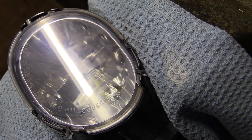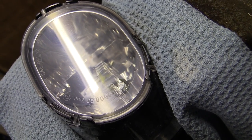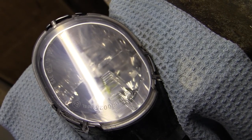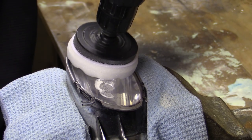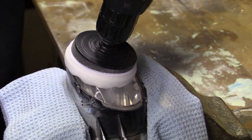Following a few hits with the pair of pads, the lens now looked like this — no heavy pitting to be seen, which was good, but plenty of light hazing which needed polishing out with the Auto Glym headlight compound. A small dollop of the smelly stuff was applied to the waffle-style foam pad before being dabbed over, gently spread, and then worked into the lightly scratched lens to instil some much needed clarity.